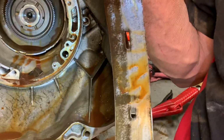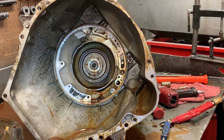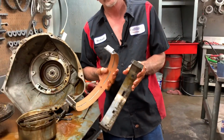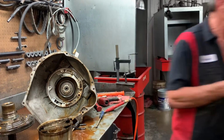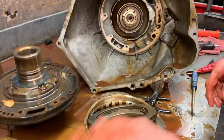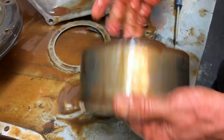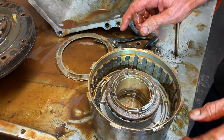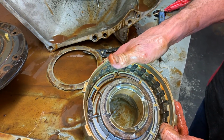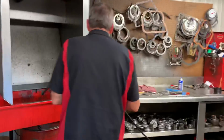Wow. Okay, so that's what that water does. It just lets the whole lining fall plumb off, and then next thing you know, you're metal to metal. There's nothing you can do. That's what tore our drum up right here too. We've got to put this in the press to take this apart. So I'm sure this drum's probably no good either. Let's go do it. I've got to see it.